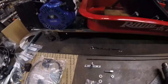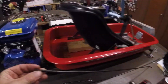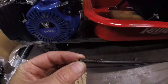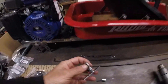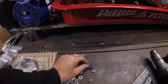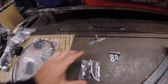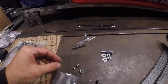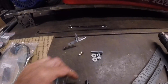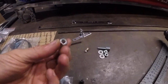Here's part of our throttle and brake control kit. We have two rods — the longer rod we use on the brake side, and the shorter rod we use for the throttle. The shorter rod is threaded with a hole, and the throttle cable will go through that hole. Then we have these L brackets bolted together, a conduit retainer, nuts for the conduit retainer, washers, and a small kit containing a return spring, a wire stop, and a nut. We'll disregard one piece and the terminal nut.